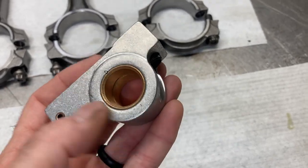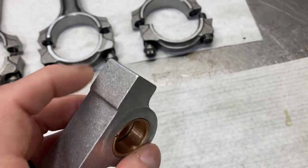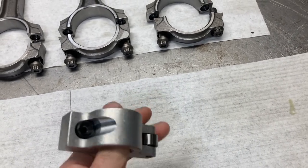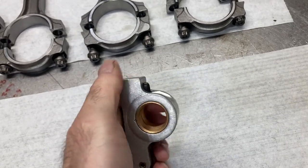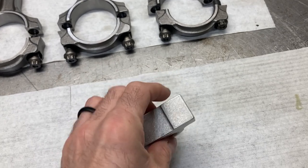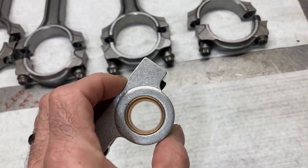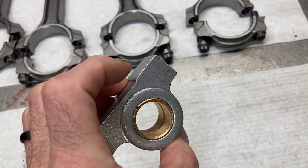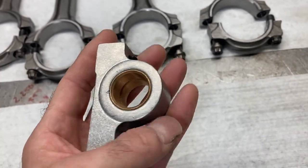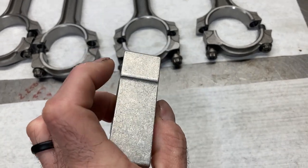These oil through either the shaft or through the pushrod, so you can use either one. The cons are that they are not adjustable, so if you want to use them on a solid cam it takes a tremendous amount of focus, pushrod length checking, and lash cap shimming — it's not for the faint of heart. These are made to slide onto a worn factory shaft without replacing the shafts. If you use them with a brand new shaft, depending on the manufacturer, you may have to hone the bushing a little bit. They are made to fit within the size constraints of a factory rocker — same width and all.